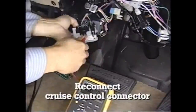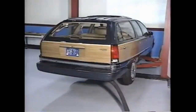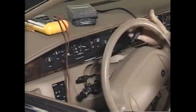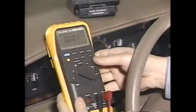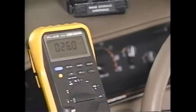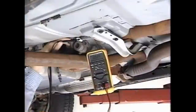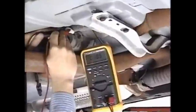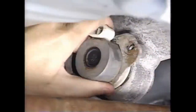If you got 5 volts originally, reconnect the VSS module, then connect the meter between terminal D and ground. Raise the vehicle on a hoist and attach an exhaust hose if required. Connect a TEC-1 — this provides you with a digital speedometer. Start the engine, place the gear selector in drive, and allow the wheels to rotate. The VSS frequency is proportional to vehicle speed by a factor of 1.1 to 1. If you don't get anything, check the sensor itself. Look for about 0.2 volts AC at 2 miles per hour and up to 100 volts AC. If it doesn't produce similar readings, replace the sensor.